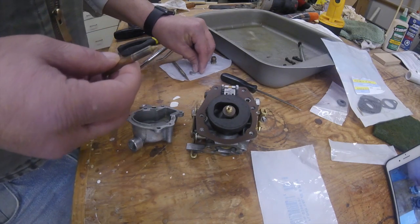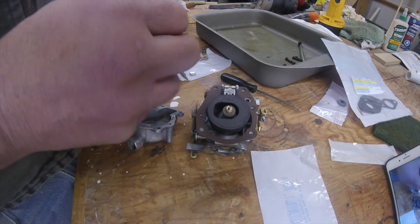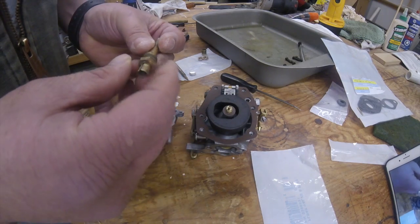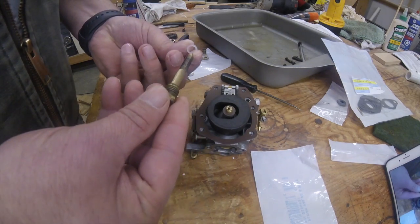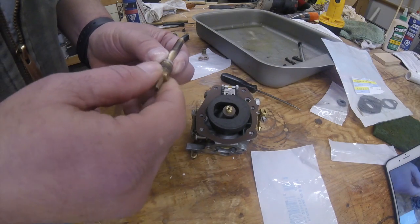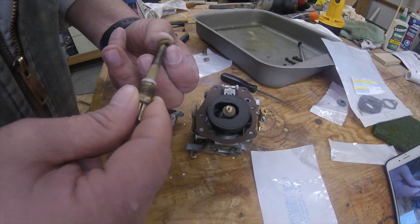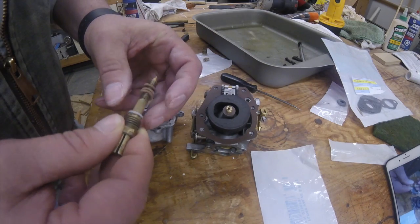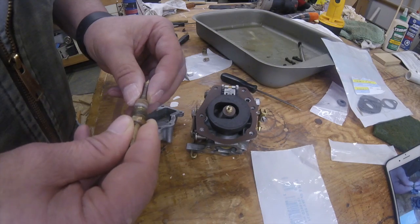What we'll do, put the nut on here, the packing nut. Then in this order, you put the nylon. That way the packing nut isn't pushing right on the packing. And you put three pieces of packing on there, just like so.